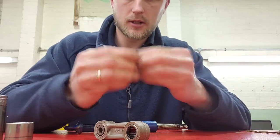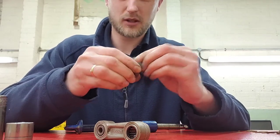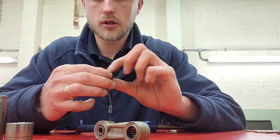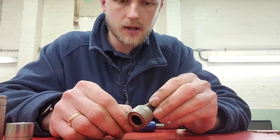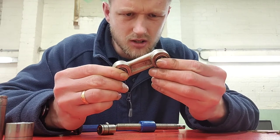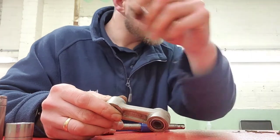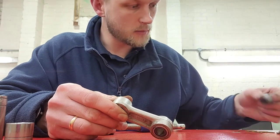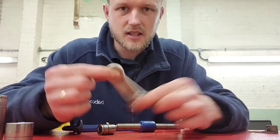Give it a good clean. This is off a 2005 but I think the suspension came off a 2003 when I bought it, so they've likely been on there for a good long while. A little bit of grease on the insert, give it some - some will push out but at least it's lubricated. Push that back in - lovely. That's it. Don't need those seals if they're all right and you haven't broken them - worth keeping just in case. You can buy replacement kits that are the OEM ones, coming with bearings, seals, and sleeves.